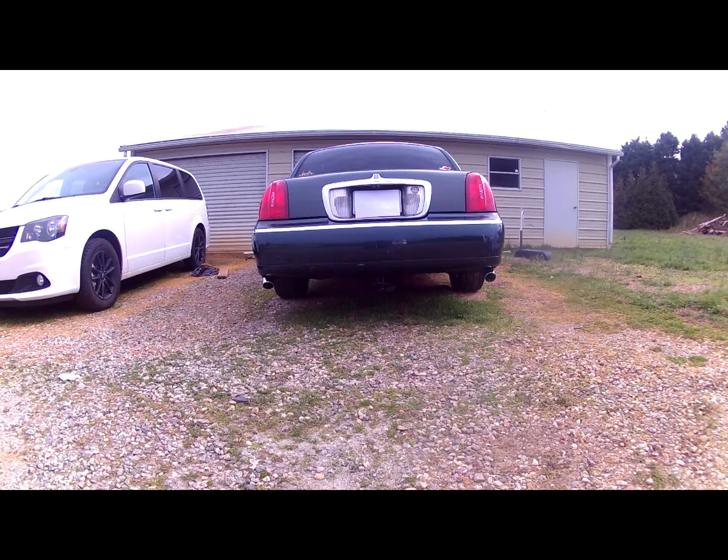...all the way out to the back of the tail. I also upgraded the rear tires with some Mickey Thompson street drag radials. They make a big difference — the car just hooks right up now. I don't have any more tire spin; I kind of miss that a little, it's fun to get the tires to scream and smoke. But my zero to 60-foot times are better and more consistent. I attribute that to the tires and the Heinous upper and lower control arm links I installed in the rear in the last video. I've been happy with them, though the ride feels a little stiffer in the back.